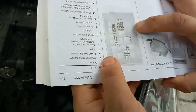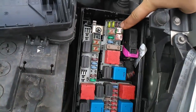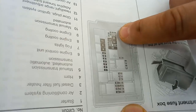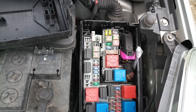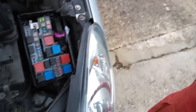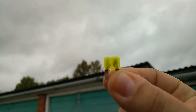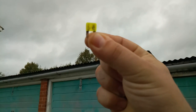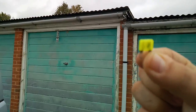I have to turn it upside down - this is number 29, which is already missing here because I took it out a couple of days ago. As you can clearly see, fuse 29 cigarette lighter is missing. This is the fuse I took out, and if you look against the light you will see it's broken.